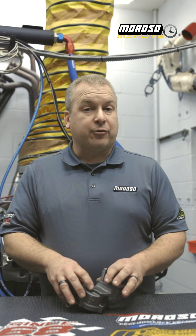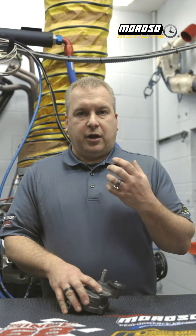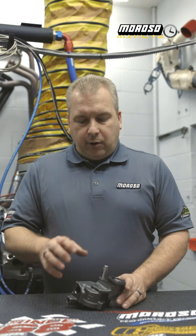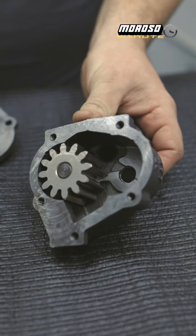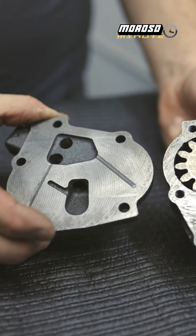When these air pockets are compressed with a gear set, it creates a lot of turbulence and will disturb both a distributor gear and potentially break a pickup off. Anti-cavitation grooves are put into the pump to allow the gear to be fed from both the front and the top and the bottom, reducing cavitation at higher RPM.